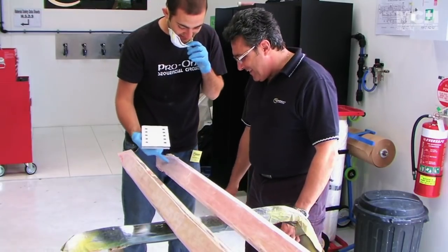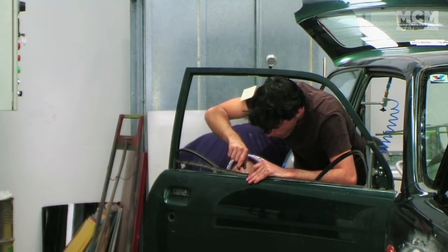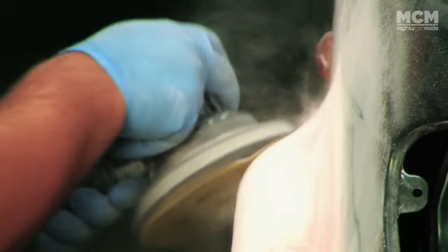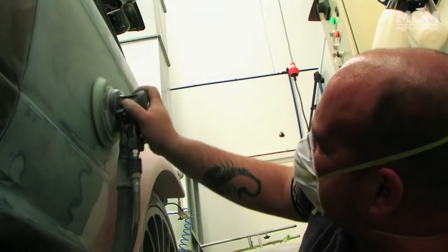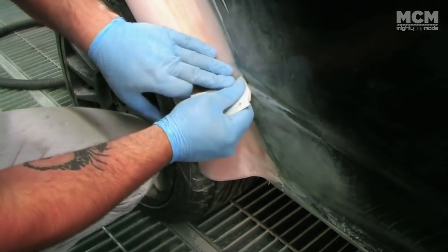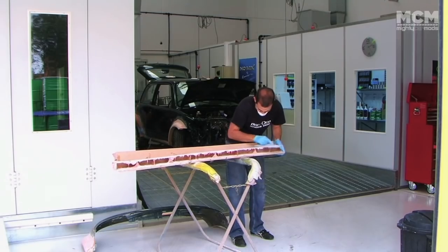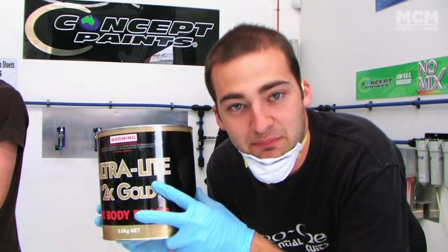Our body kit was attracting some attention, and it wasn't even on the car yet. The body kit and the old paint is sanded back with 400 grit on an air sander, which saves a heap of time and elbow juice, while the fine details are done by hand. There was no bog, so they went into the factory just over there and made us some bog fresh. Taking the headliner out so we can take the antenna off the roof.